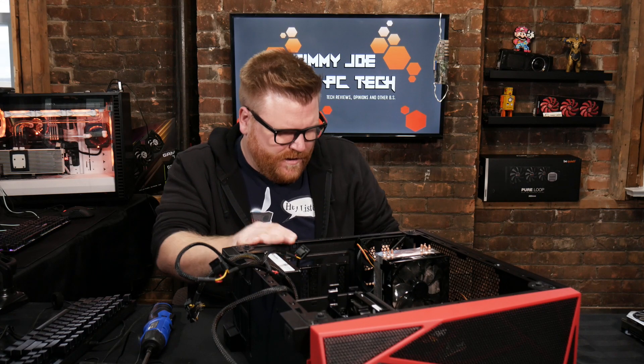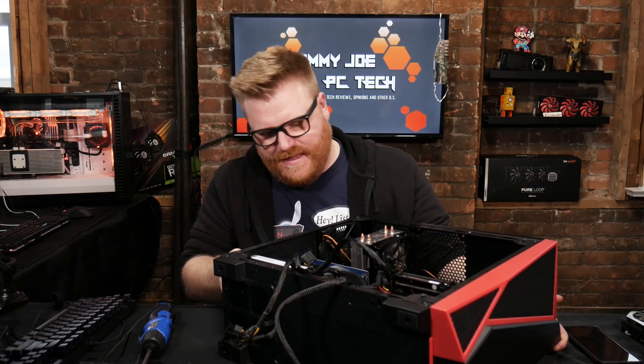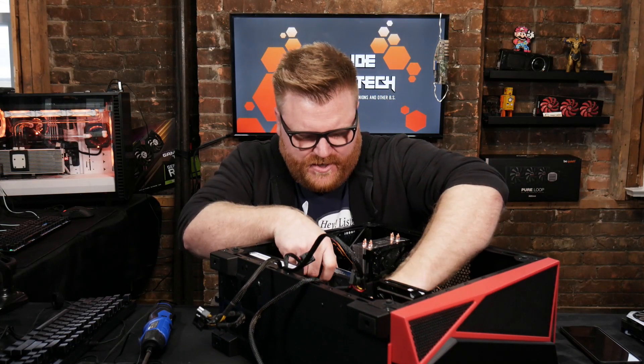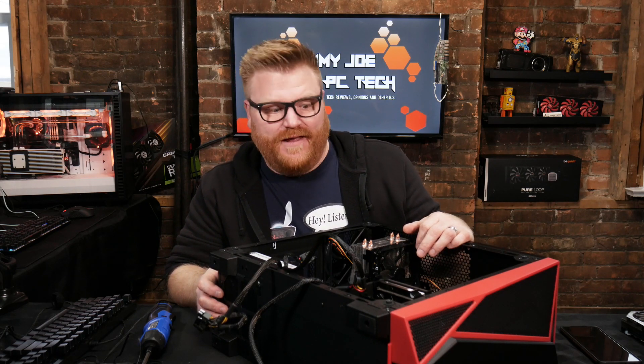That's gonna make the rest of this video short. I just wanted to chime in and say I'm an idiot — check your connections, all of them coming from the power supply. Surprised he didn't fry anything. There's no onboard graphics, so I'll grab my trusty GT 1030 that I use for testing, put her in there, and try again. Another little jiggle — so it wasn't the video card. You just gotta go through process of elimination. I'm going to take the motherboard out, because I have a feeling I'm going to need to in order to get this working.